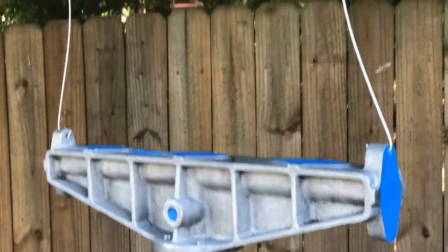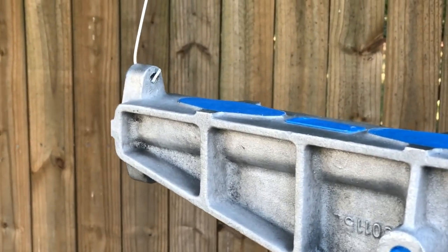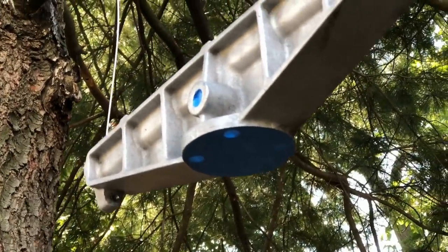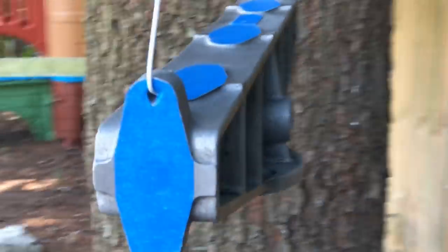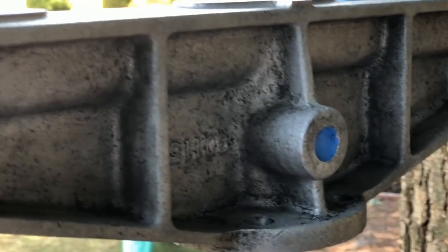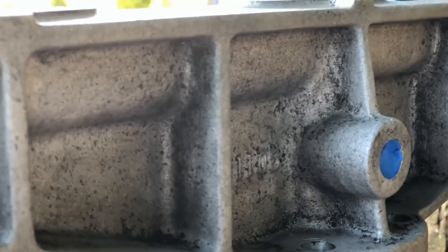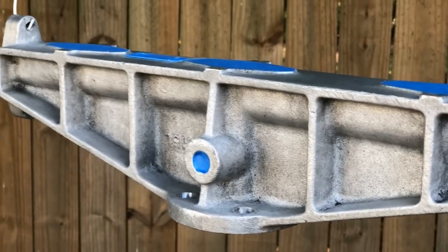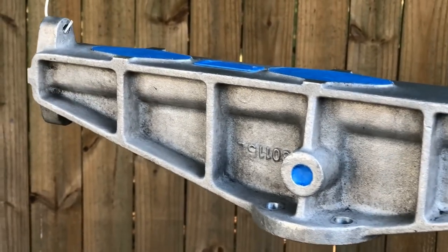To paint the manifold, I used an old coat hanger that I cut in half at the bottom and bent little hooks into each side so I could hang it, as you see here. This way I'm able to paint one coat on all the sides without having to handle the part. I taped off all of the machine surfaces that I did not want clear coat to get onto, including the builder's tag or serial tag. This part in particular has quite a bit of material still on it — from what I gather, this is some sort of anti-skid spray that was near the roof of the locomotive and oversprayed onto the horn. Even with light scrubbing and all of the chemical washes, that was still on there. I figured if it's going to stay on that hard, I'm fine with it having a little bit of an in-service look.